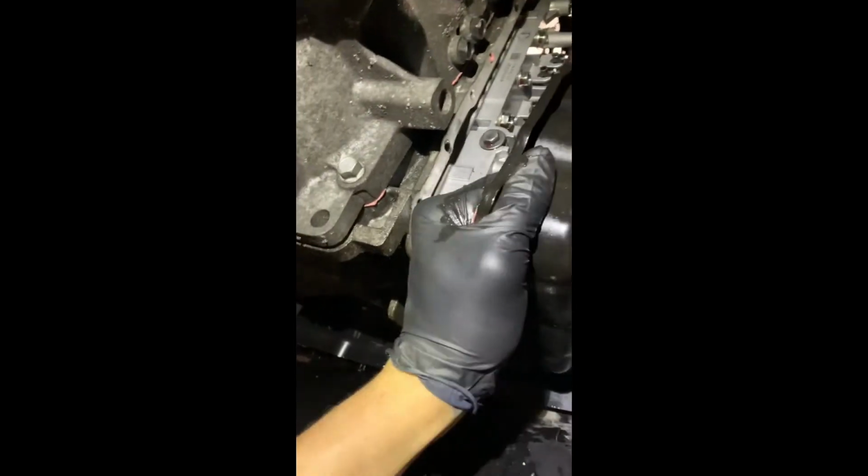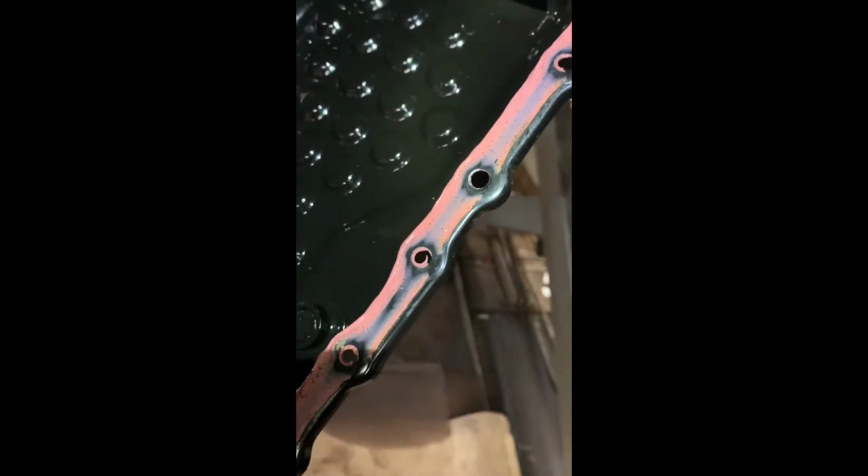Once you get those bolts off and drain, you pull this off, okay? You'll be down to your valve body. You're gonna make sure you clean that surface before you reglue it. Move that over. Okay, then here is your sensor, okay? That's all there is to it. There's a 10 mil, take it out, get it out of the way.